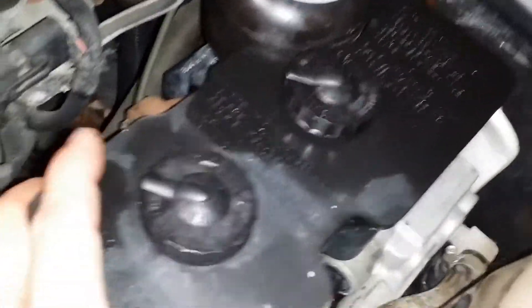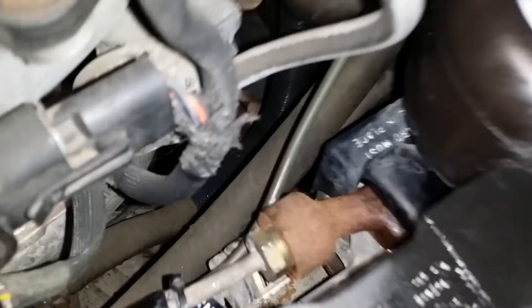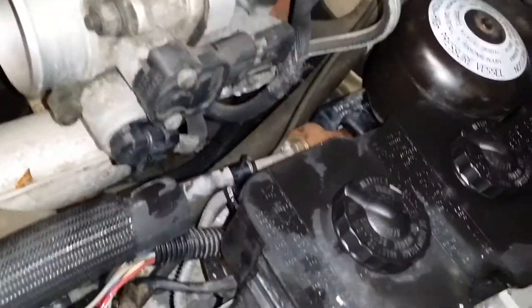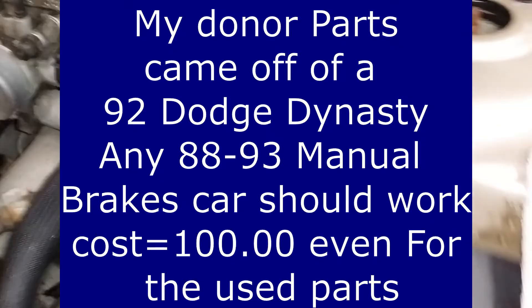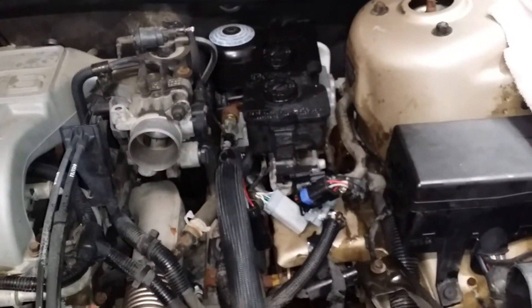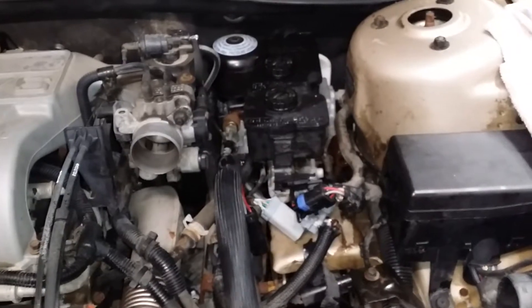Now that I've got all that loose, you can see the whole assembly is starting to move. I haven't detached any of my brake lines or anything — I was kind of hoping I'd get a little more space. Here's a brake line coming in here. The website recommends just cutting them off; you'll have enough excess to re-flare the ends. So in summary, what I'm trying to do is convert from ABS to manual. I'm going to cut the brake lines first with a pair of clippers and then re-flare them later.